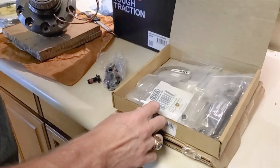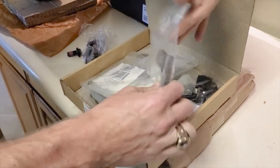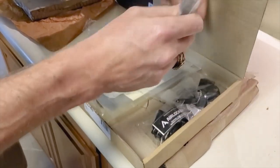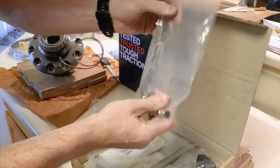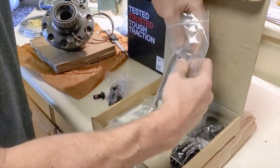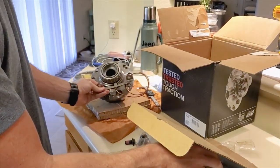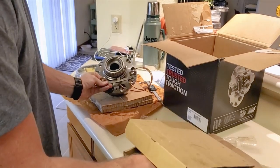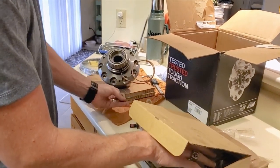This is a really neat thing about the new ARBs. There's some new hardware in here. If you've done brakes before, there's something called a banjo bolt in here — there's a washer, a crush washer, and a banjo bolt. This piece bolts into your Dana 44 and gives you the strength and stability to hold all of it together, so it doesn't walk and wander around inside the diff, and it protects the copper line inside there.